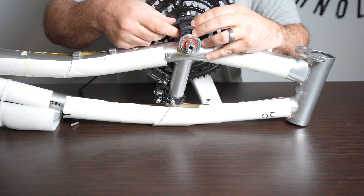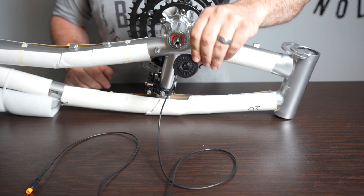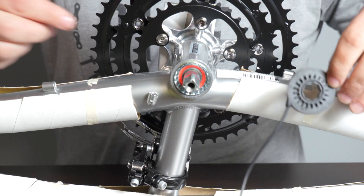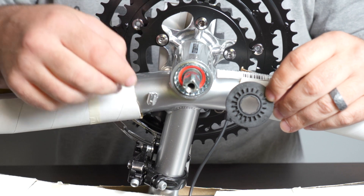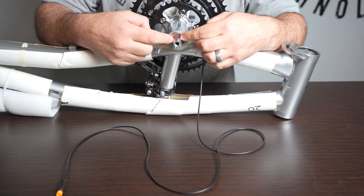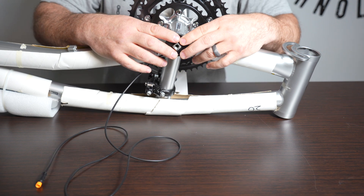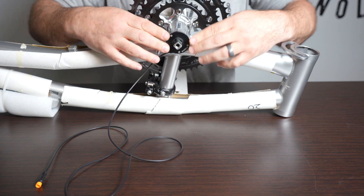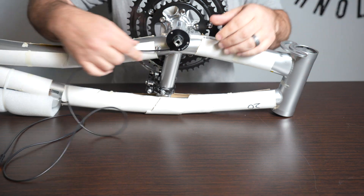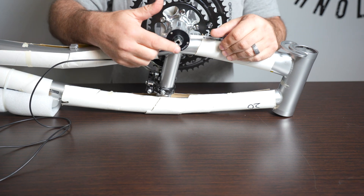The next option is called the Mini 3 PAS. This is a left side sensor only, made for square taper bottom brackets with internal splines. This is an Easy 3 HD — as you can see it has internal splines and a square taper. In order for this to work, the thickest part of the taper cannot be more than 15.6 millimeters. You just put it on and slide it in — the spindles will connect. Make sure the cable is heading towards the rear of the bike towards your controller. This does involve removing your crank arm to install.